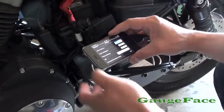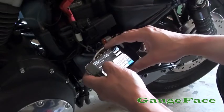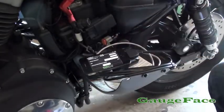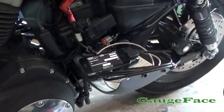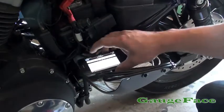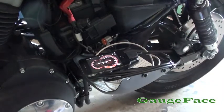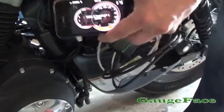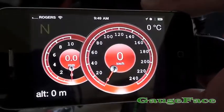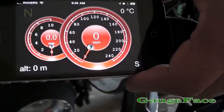What I can do is override my voltage calibration to account for that difference of 2 volts. By default it was set to 1.2, and that seems to be about the right place for a lot of bikes. But I'm going to go with what we just tested and override it to 2. Starting the bike up again, now we're reading 12.9, which is a much closer indication of reality — a full charge.